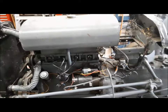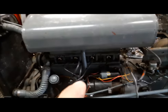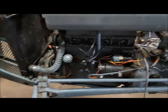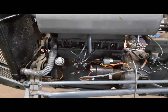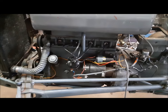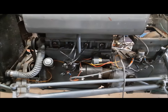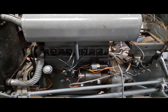So we went through the carburetor — and you saw that on the vice — plus the last time this tractor was here I took that carburetor off and put it on one of my Fords and it worked perfectly, so there's nothing wrong with the carburetor. Gone over the ignition completely — tested the condenser, checked the points, set the gap, made sure the shaft bushings in the distributor were good, no carbon tracking or cracks in the cap, all the wires check out good, spark plugs check out good — and it's still just not there. The idle is just not happy.